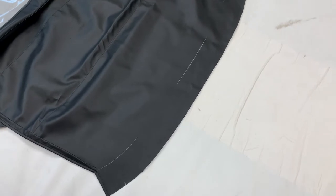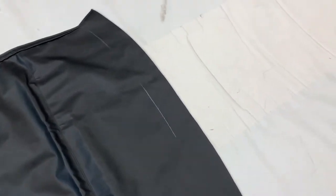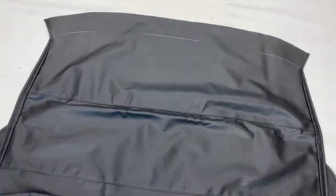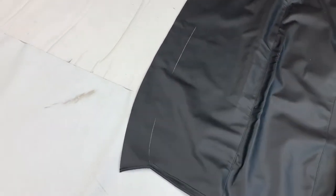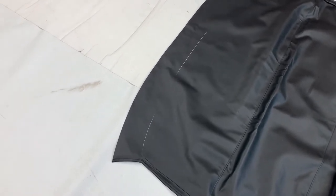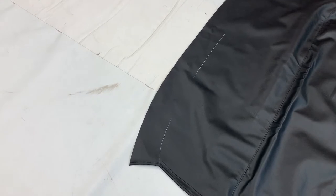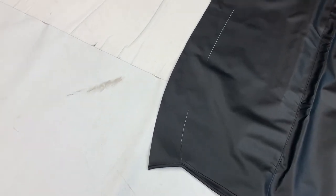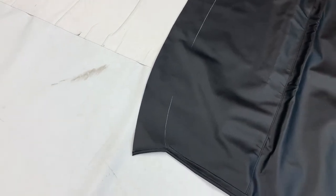You'll notice this front edge isn't edged, and you've got the white marks on there. It's basically excess material which allows you to wrap it around the header rail section of the hood and secure it in place. The TR6s and TR5s use a setup where you wrap it around and then the header rail is secured into place on the windscreen frame using those lever handles.